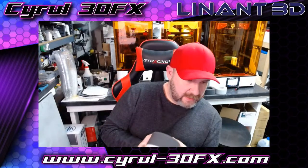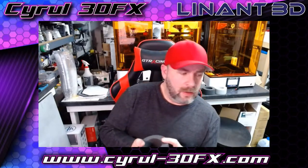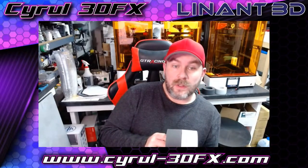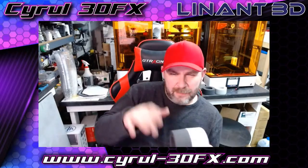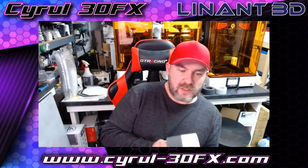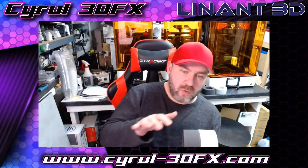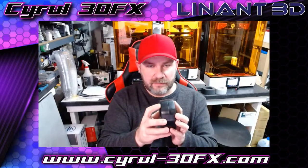On the next video, when I have the pre-production samples — those shipped out and should be here tomorrow — I'm going to mount up all of them with soft, all of them with our medium, and one style with just air pressure, then get some durometer readings and make a chart of where everything stacks up. With the taller sidewall on these, I really recommend the foam because you're going to have a lot more lateral support.